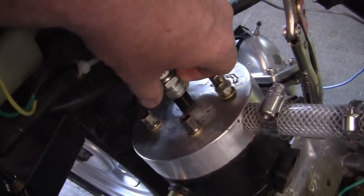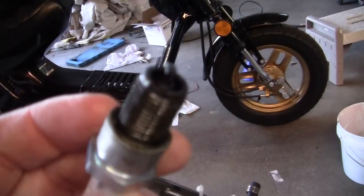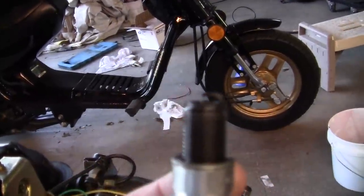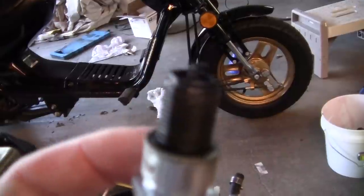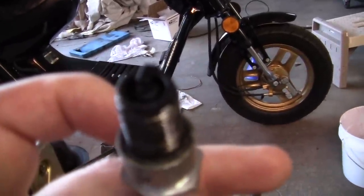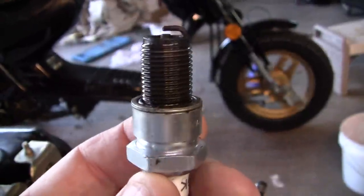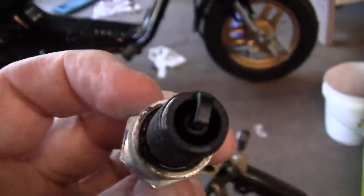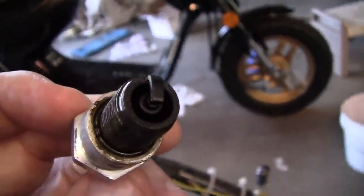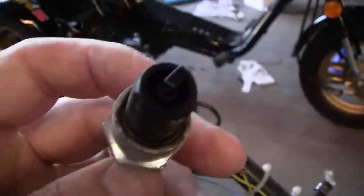There are many books and everything on the web that you can look at, but this can tell you a lot about your bike if you look at it. If there's pitting, like here, there's a lot of black on here — that could mean a couple of things. One, that I have way too much oil in the plug. But this oil looks a little bit shiny, so this tells me I've got way too much antifreeze in the cylinder from the last time.